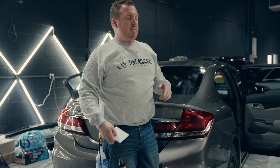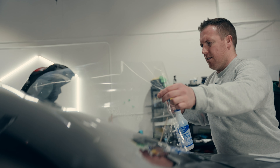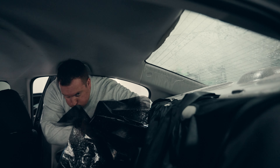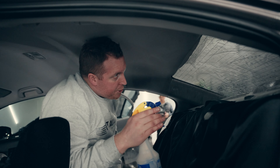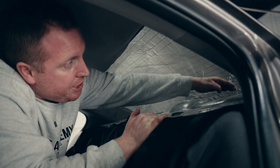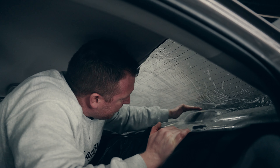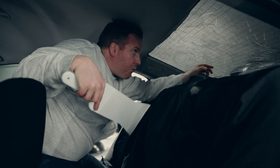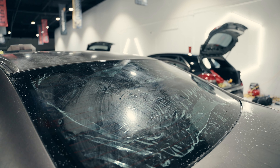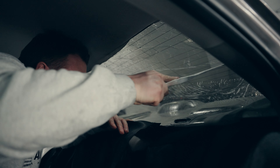Now we've shrunk this and we're ready to install. Before we install the film, we're going to do one more clean spray and squeegee. Now we have the film on the glass. Before I take a squeegee to it, I'm going to spray down the glass. With my hand, I want to get out any big pockets — if I take a squeegee to this it could cause a crease or damage to the film. Once I get all the big pockets out, I'm going to take my bulldozer and follow my same H pattern, coming across the center and then down to the side.